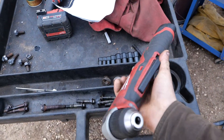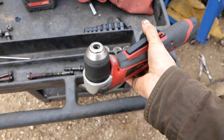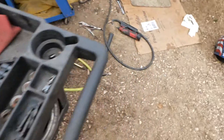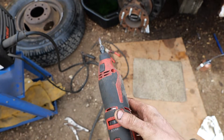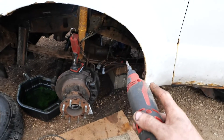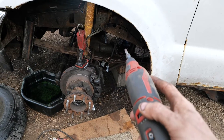We're going to do this right. I took a drill — if you can get your hands on one of these, a right-angle drill. This thing worked wonders for me. It's very critical at the beginning that you get a nice centered start. Before I did any type of drilling, I centered the pocket in the bolt with this tool right here. Jacking up that engine is critical for gaining good access for drilling and other things.